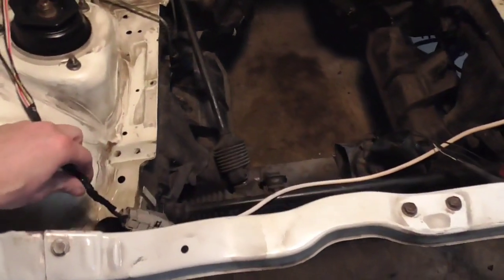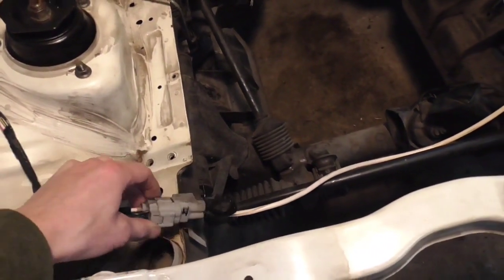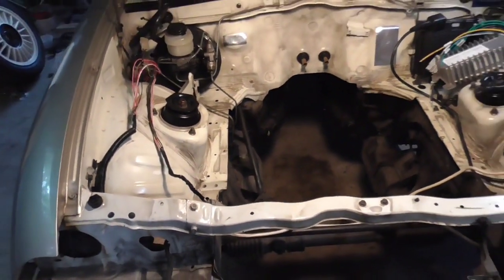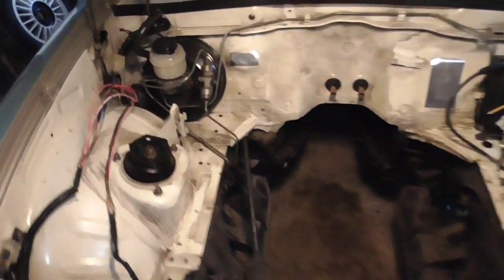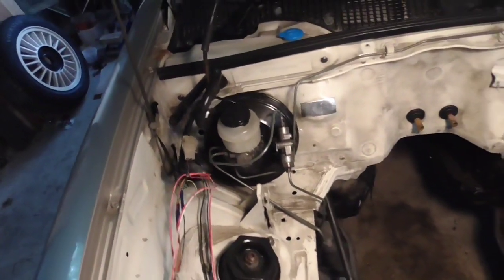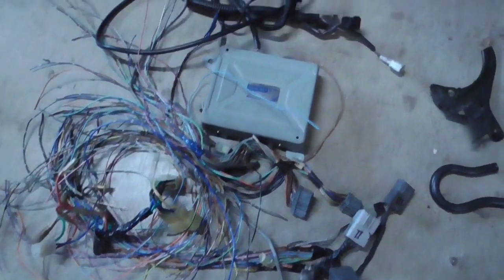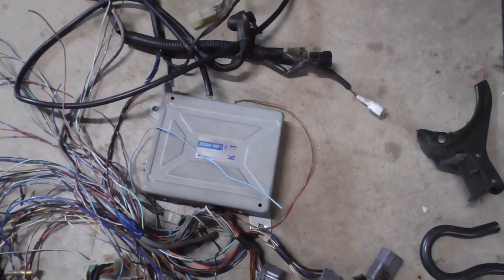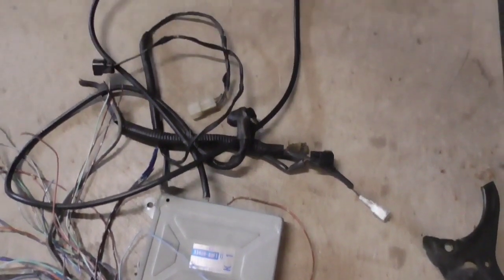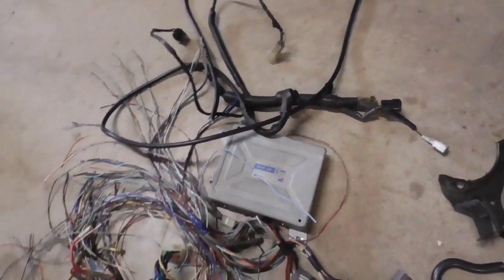And another thing I've done is I verified there's only one wire that we needed to keep here. I didn't mention, we tore out a bunch of the wiring, so as you can see, I cleared off a bunch of that junk. I actually traced the wires back into the car and took out all this stuff right here. This is all gas stuff, so just various wiring, the control module for the fuel injection system, and then we had a starter cable, which was a big fat wire. All that was about 4 pounds right there, so that's some more weight out.